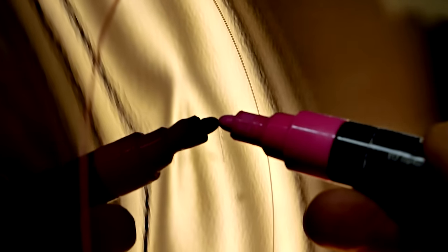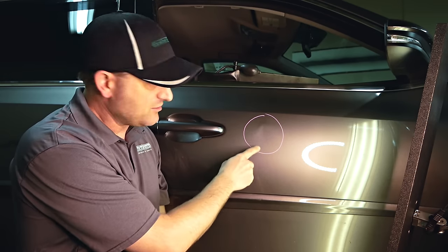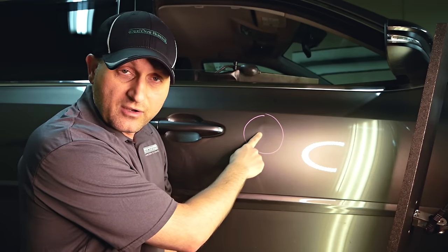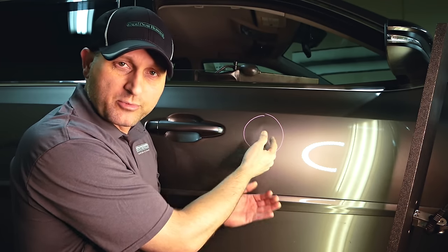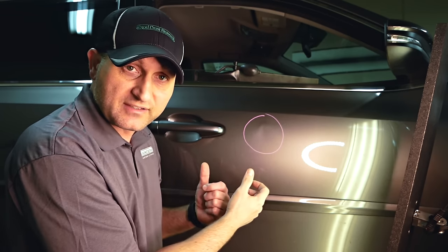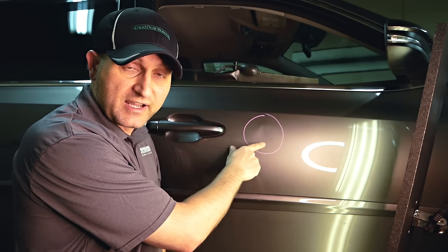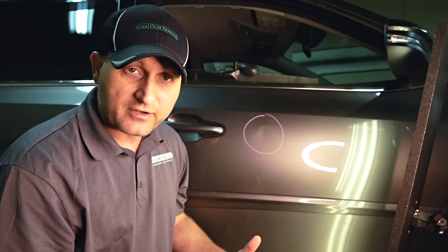What I'm going to show you first: typically we'd knock down these crowns about 50% to take some of the pressure off so I can push out the damage. But to show you the difference, I'm actually going to push the center of this damage a little bit first with a soft tool — probably with some tape on it — to try and bring it up before knocking it down, just to show how much trouble it is without releasing that pressure first. Obviously, doing it the other way, I could fix it faster and do a better repair.